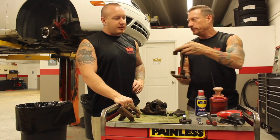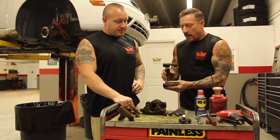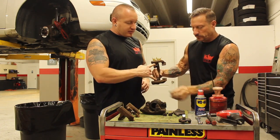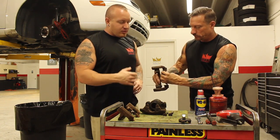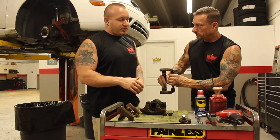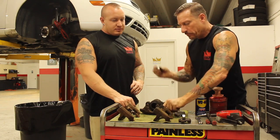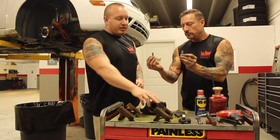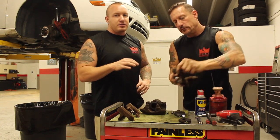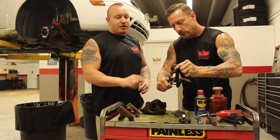What are we holding up right here? That is the brake caliper mounting bracket. This is what the brake pads sit in. I see this is really clean here compared to that — why is that? So that's just your channel where your brake pads actually sit on the upper and lower portion. They all have channels on them or pins depending on the style of brake caliper and the bracket. Every one of these designs will be different, but still fairly easy to deal with when maintaining the service. These bolts are the actual mounting bracket hardware bolts — those two large ones hold the bracket onto the A-frame or the control arm. And then you also have slide pins that hold the caliper onto that bracket.